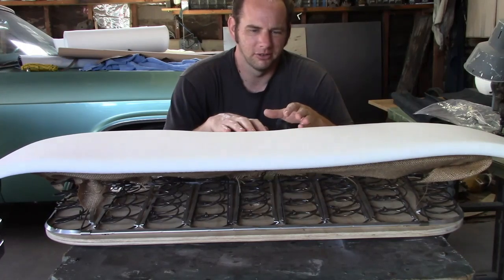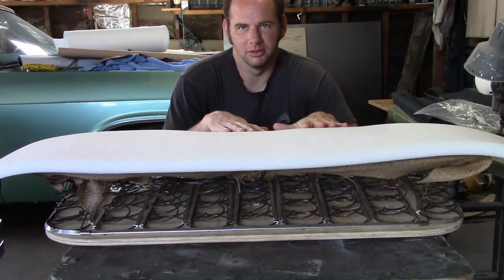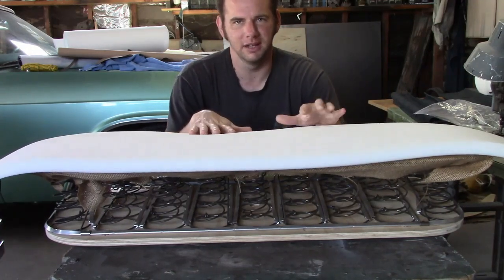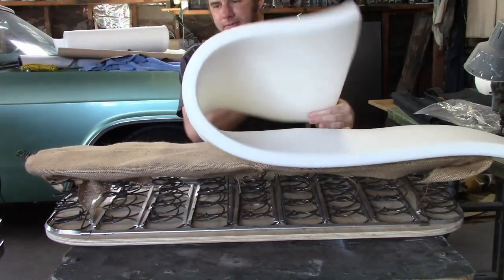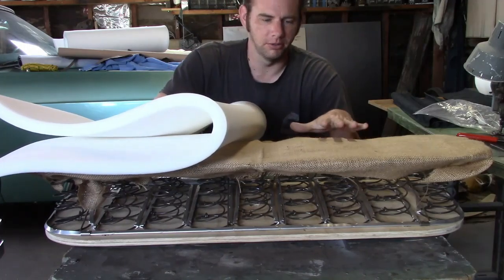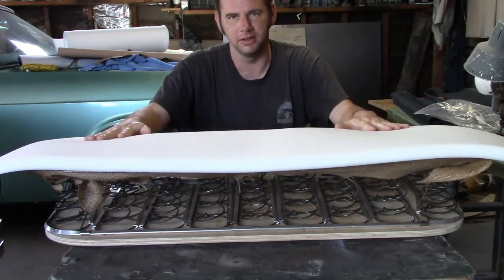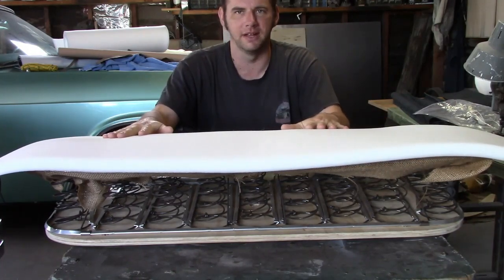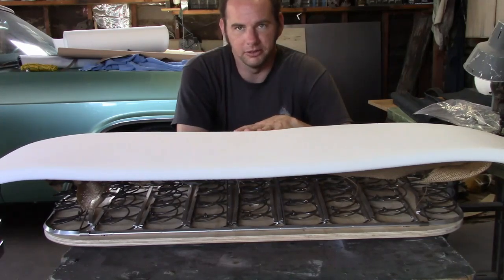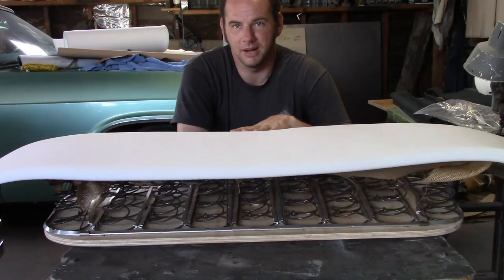Another big reason is today's audience is more accustomed to modern car seats padded entirely with foam rubber, so going for a more authentic feel isn't really worth it. The big problem I've seen people do is heavily over-pad the seats. There's just a layer of burlap, then an inch-thick layer of foam rubber, and that's it. The springs do all the suspension and cushion — this is just a layer to equalize the top. Most interior kits come with way too much padding; I've removed probably about half the padding from the few kits I've installed.